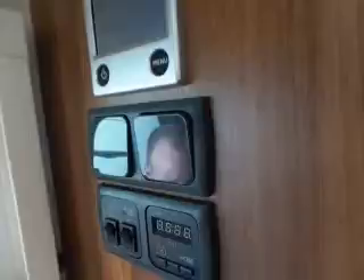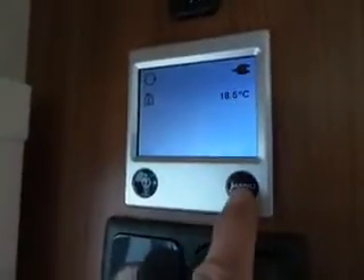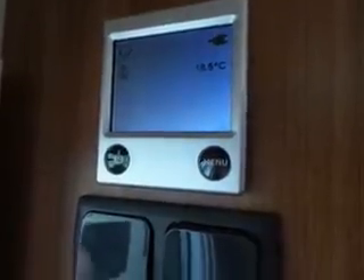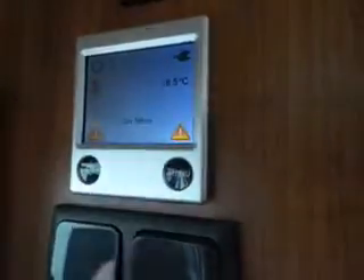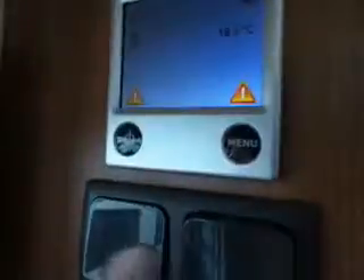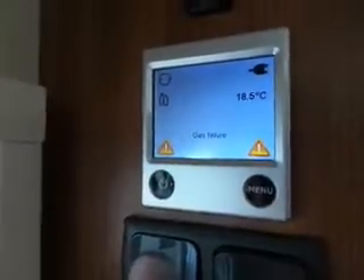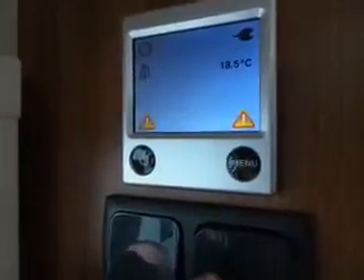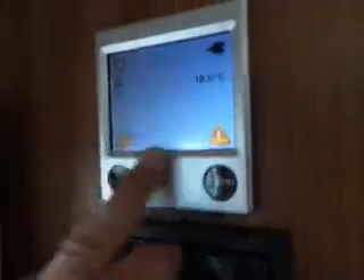There's the heating. Your heating system — I'm not very up on these, I'm afraid, because I'm old school. You want to just get up and switch the heating on. On/off button is there — so that switches your system on and off. What you've got on the top left is your circulation — the central heating circulating around your van. I might not have enough gas in that cylinder. That's why it's showing gas failure, and that's why that was clicking there — I may have run out of gas. He's telling you it's running out.